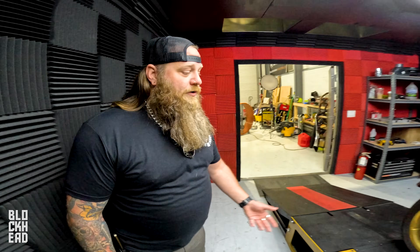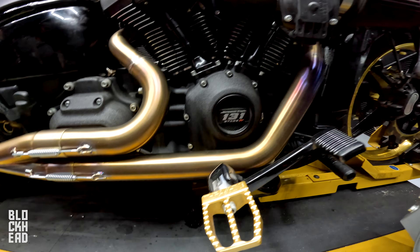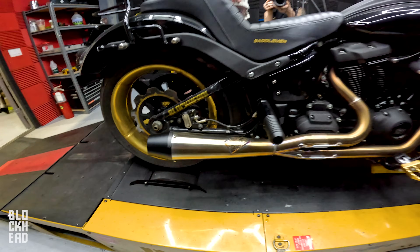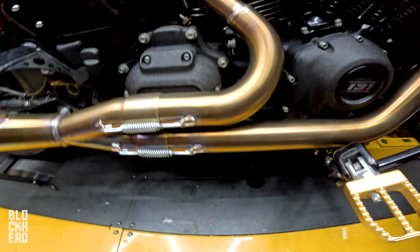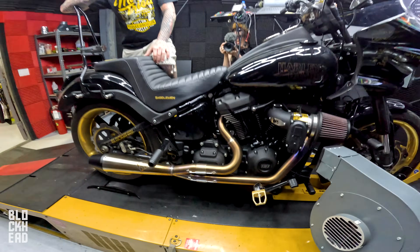This room scares people because we call it the truth — it shows you what you're actually getting in terms of performance. If someone just throws an exhaust together without real thought, we're going to see that. So what is on here? We have the Milwaukee-8 Softail exhaust. This is our long pipe, two-into-one, stainless steel 304, 100% made in the U.S., actually in Denver, North Carolina — about 30 minutes north of Charlotte. It's a two-step pipe coming from an inch and three-quarters going to a two, and we have our hand-merge collector for maximum flow.